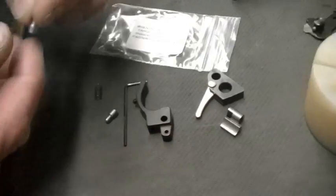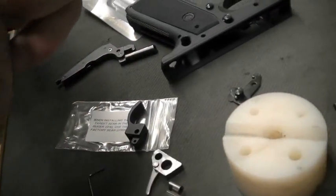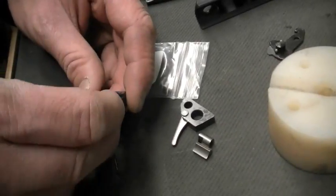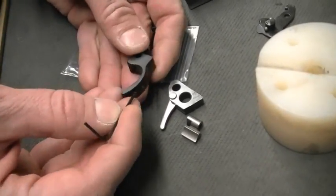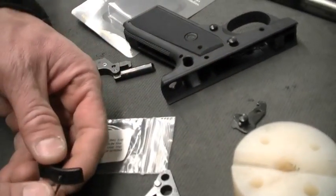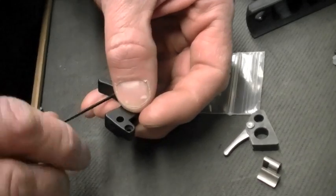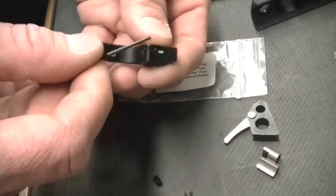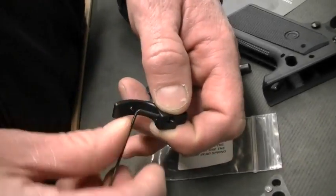Here's the plunger and the spring. So that's the stock one, and here comes the plunger spring. Before we do that, we're going to take — this is the over-travel screw here, this is a pre-travel screw. We're going to back both of those out and shoot it with brake cleaner. The reason why is because you absolutely, positively have to Loctite this stuff. If you don't, you're going to have issues — that screw is going to back out on you. I've installed three kits of these and they're always loose. What color of Loctite? Blue would be fine — that's what I use. Red, when you have such a delicate piece, I probably would not recommend.